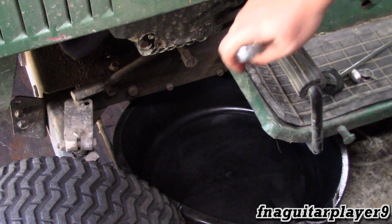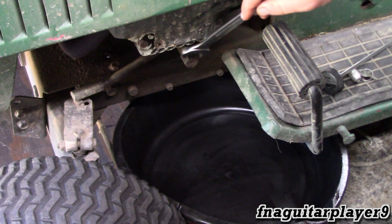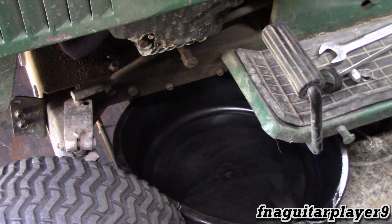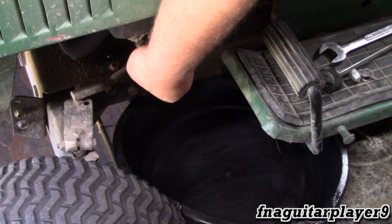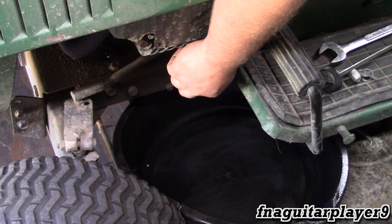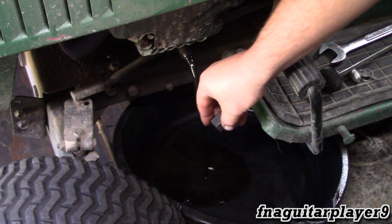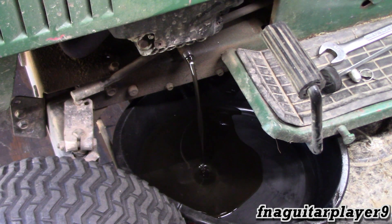If you're a subscriber, you know back in summer I had a problem with this motor — the crankcase filled up with gas due to a carburetor issue. I haven't changed the oil since I put it in, and this is a cheap oil I put in there just in case the problem happened again so I wasn't wasting the good oil. You want to make sure the oil doesn't come rushing out in your hand — it's going to be hot and it's easy to get burnt. Let your motor sit and drain, and we'll go ahead and get the new oil ready.